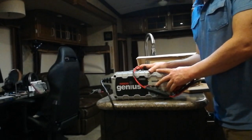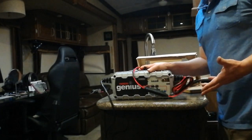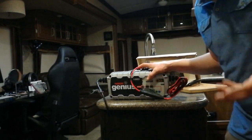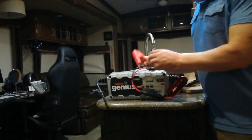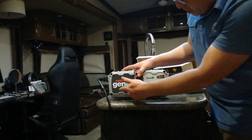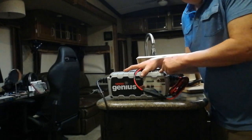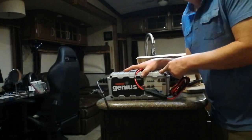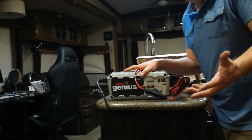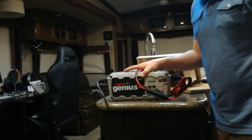I just hit record and then filmed the whole segment of this unboxing of the Noco, and you guys get to see only the very end because the recording failed. That's like the 10th time — I lose so much video because I don't hit that stupid record button. But here it is — how do you pronounce it? I want to say Norco, but it's Noco Genius. This is the 26-amp version. My last one was a C-tech and it was only seven amps, so it would have taken a couple of days to charge my 500 amp-hour battery bank — four AGM batteries. At least this one should be about 24 hours.